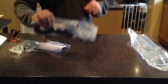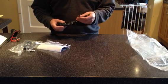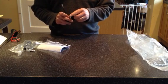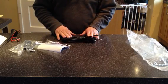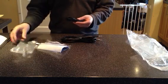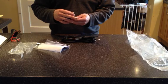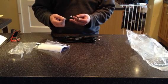So you also have in the box the aerial extension cables. This one here is for the AM and FM. You'll notice that it has a Hirschmann male connector on the end here, and that goes to a DIN aerial connector on this end here. That cable is 5.5 meters long. And here's the DAB aerial on this end here, which connects to the aerial itself. This is an FME male connector. That's what comes out of the aerial itself, and that goes to a standard SMB male connector.